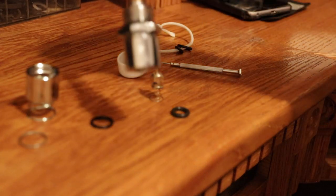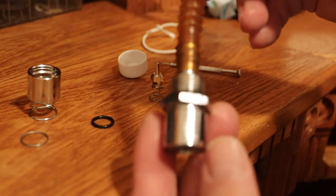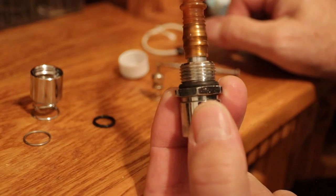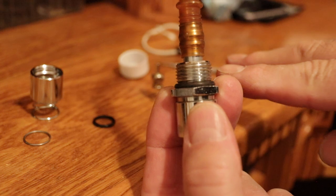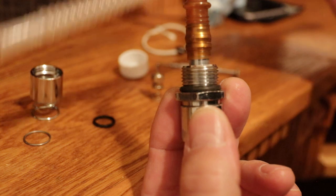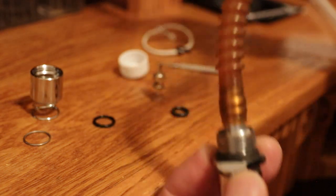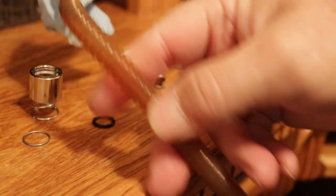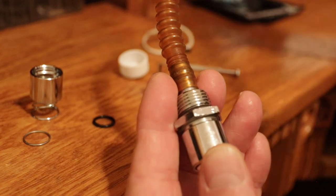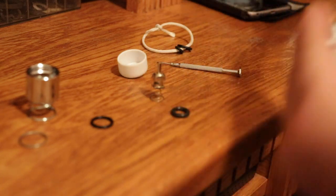This check valve here is the one that came out of my bike — it's the high pressure valve. My tank has two on the bottom. One's a return and it has a small hose on it, while the high pressure has a long 22-inch hose. I bought one about 18 inches thinking it was the right one but it wasn't.